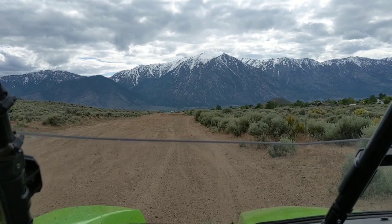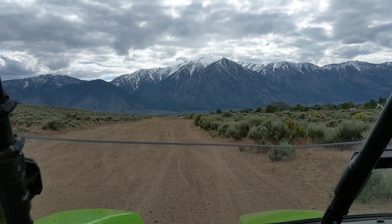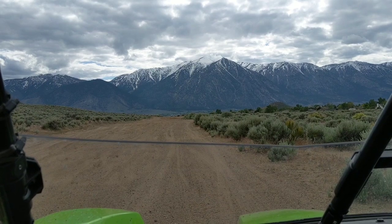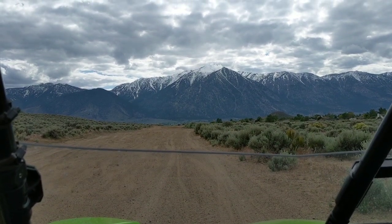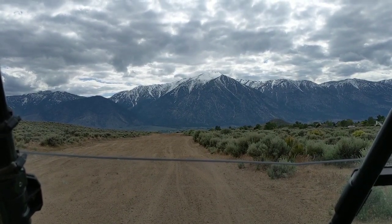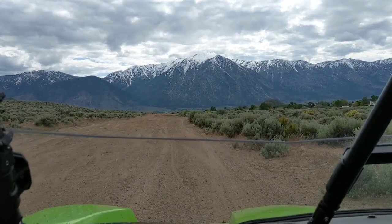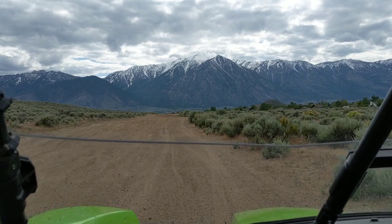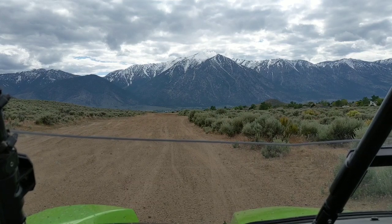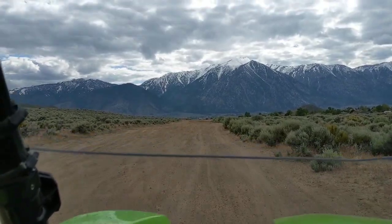I went up a little canyon here, and you definitely get more articulation. So I'm going to take the whole sway bar off for a while and see if there's any other fixes that come out, or possibly get some kind of a two-piece clamp to do what the tabs did on the other one and keep the sway bar from moving side to side. And they can be mounted inside or outside of the bracket, bushing bracket, but it's not going to be an easy piece to find here locally. All right, ride some more with me.